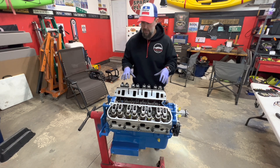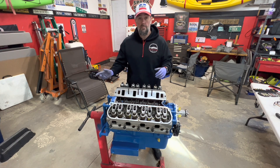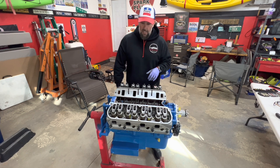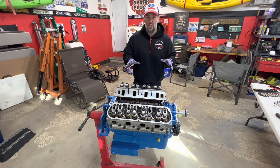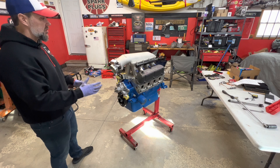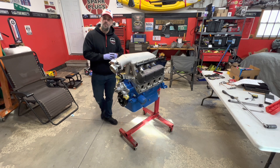I'm not going to put the valve covers on permanently yet because we still need to get some LS coils — some GM LS-type coils, doesn't matter if it's from a truck or whatever. I'll need to modify the valve cover to sit the LS coils on top, run regular GM ignition wires. I don't want to relocate them to the firewall — I want them right there, easy to access and service. Here's a sneak peek of what it all looks like together. The intake is just sitting on here, and so are the valve covers — not bolted down, because when I drop this thing back into the car I don't plan to have the high ram on there. We're still a while away from dropping this back into the Mustang.